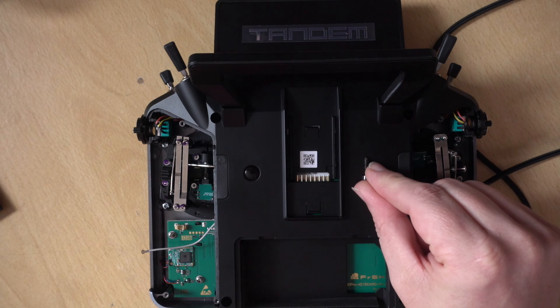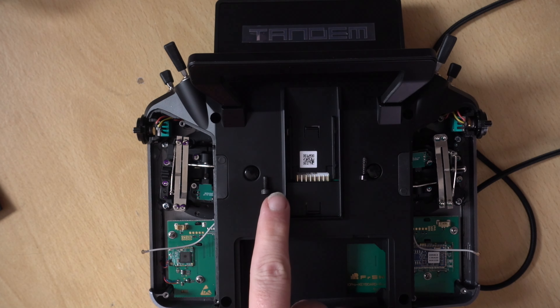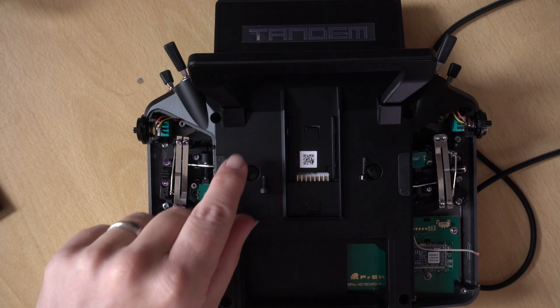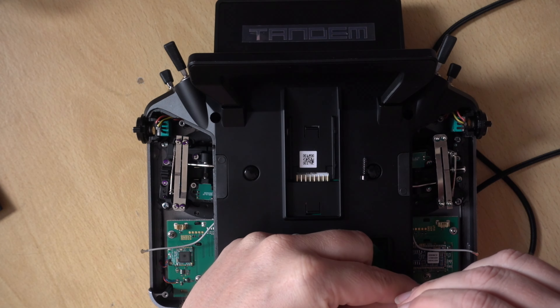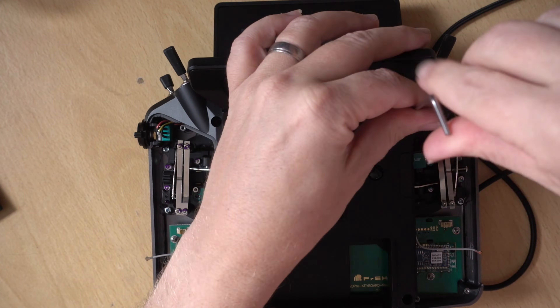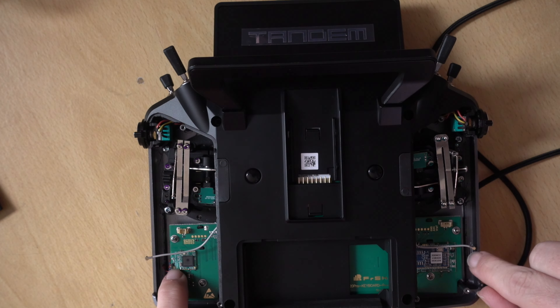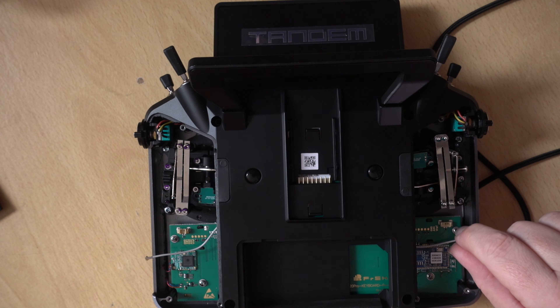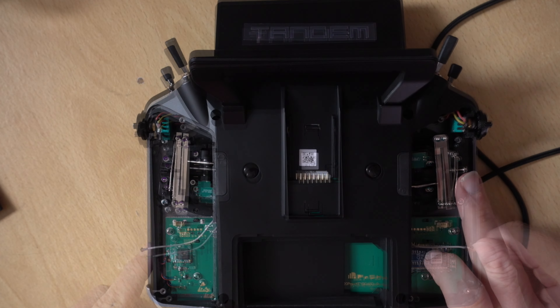There are two types of screws in the back of this radio. There are pointed screws and there are machine screws. The machine screws go at the bottom because they're screwing into the aluminium. The pointed screws go at the top because they're screwing into the plastic. This is a 2.5mm hex key. The final thing would be to reconnect these little Bluetooth antennas to these two little connectors. I'm not going to do that on camera because these are IPEX 4 and they're extremely small and delicate. If you're taking these off, be very careful when you remove them — it's very easy to damage these antennas.